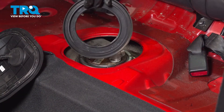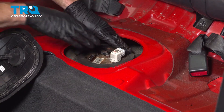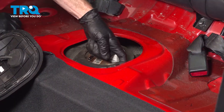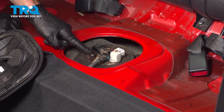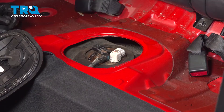We've confirmed everything's nice and tight. Let's put on our protective rubber cover — this just slides right on over that locking ring. With that in place, we'll continue on with our fuel line, bringing it right on over. Take this and get it in position on the fuel pump assembly, press it in, listen for a click, and give it a tug to make sure it's secured properly.